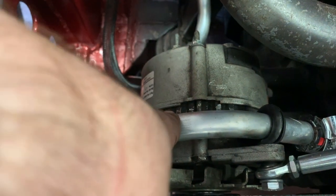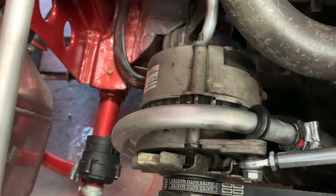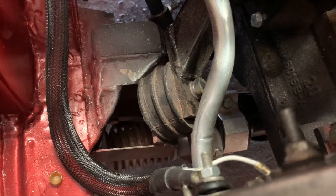That's one quick job done, on to the next. One thing I'm going to do next is what I've got listed as the coolant bracket — a little bracket for one of the hard lines I made in the engine bay. This hard line I made for the coolant reroute is wedged in place by an O-ring at the moment but it floats around a little bit, so the plan is to put a little bracket just down there off the engine mount that wraps around that line to keep it more secure and stop it from bouncing around.